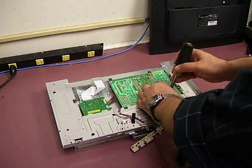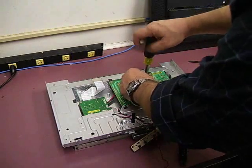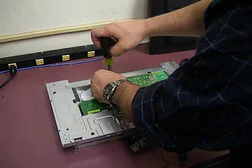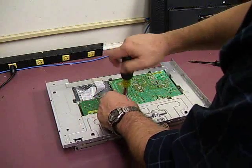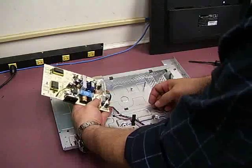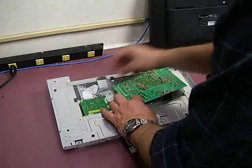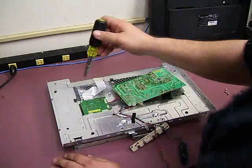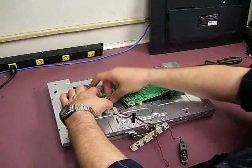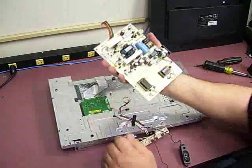This is the back of the power supply board that we're going to be removing. We have a couple of screws. Now we can start to lift that board up and work it free. We'll need to unplug the power supply board from the video board — probably the easiest way is to loosen a couple of screws so we can lift up the board just a little bit and get to that plug. Now we have it unplugged. We need to unplug the speakers from the board, and now we have the power supply board.